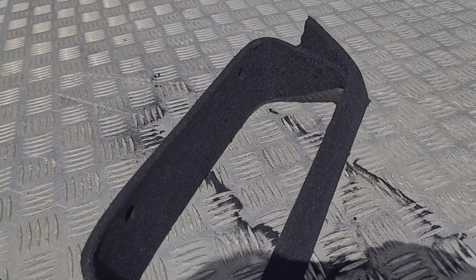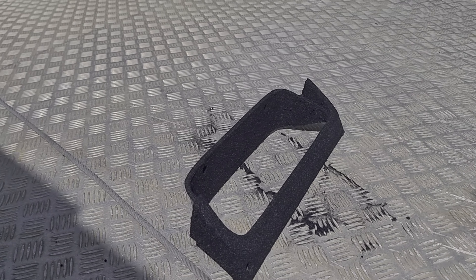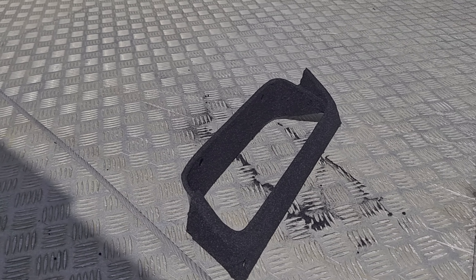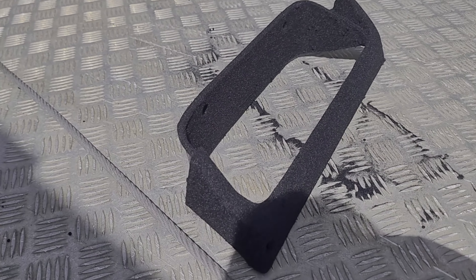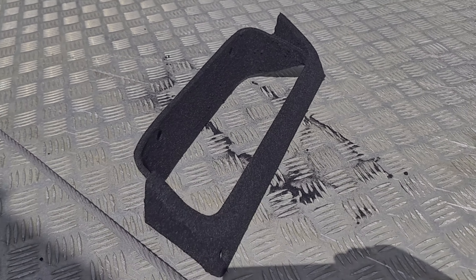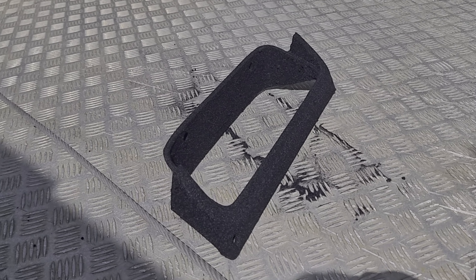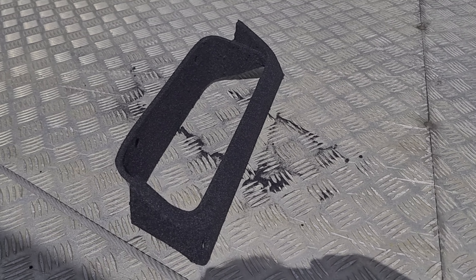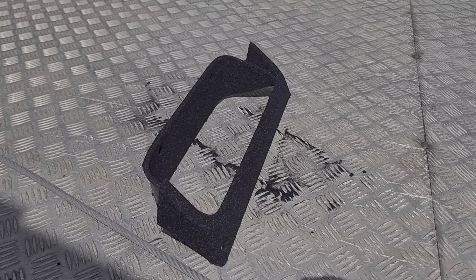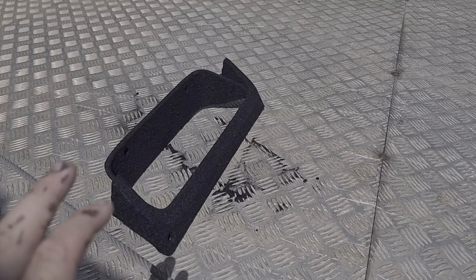I've been doing a bit of DIY flocking. With those DIY kits, there's just not enough flock in them — you're better off buying the big bag, or even better, buy the glue and the flock completely separate, don't buy the kit. Waste of time — comes with a flock applicator that just doesn't spread it right. By the time you've got enough on, the glue's dry. What I've done is just got a bowl and a big plate, glued it all, set it on the plate and just rubbed it with my hands and dropped it all over. Gets it done quick and easy, then I put it outside to let a natural breeze take the extra bits off.